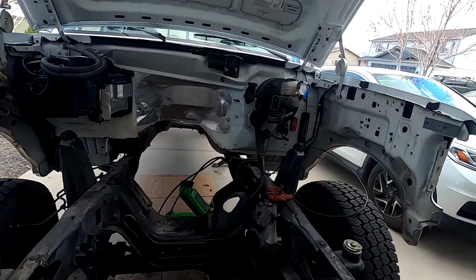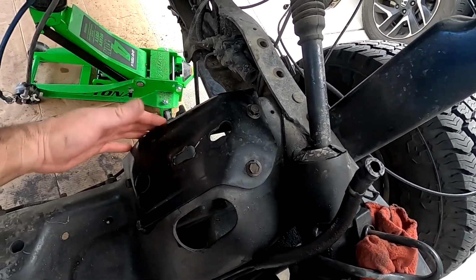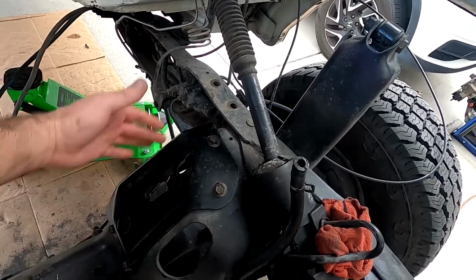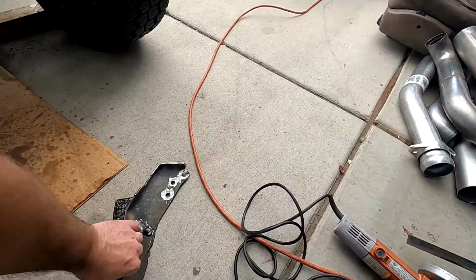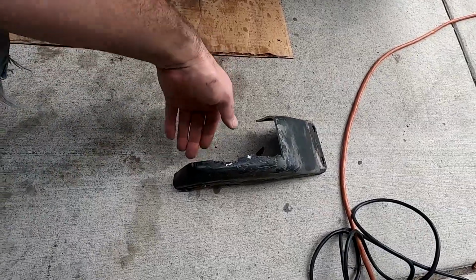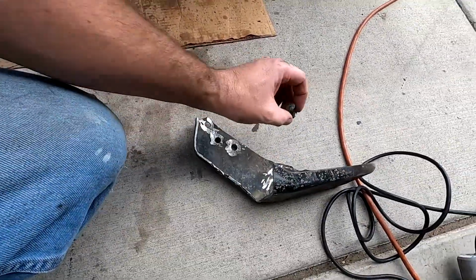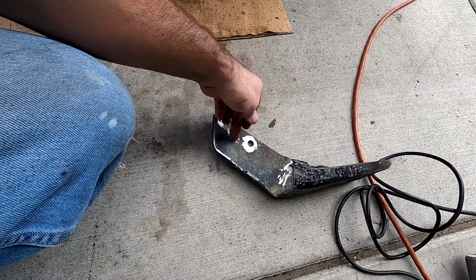All right, guys, we're back. So I got the 7.3 motor mount installed. That other one, just a pain in the neck where they had all that stuff riveted in. I couldn't get a grinder up underneath there from either side, and I couldn't get any kind of chisel or cutting bit in there. So what I ended up needing to do was take my Sawzall and basically cut a section of the mount out so I could get to these rivets from the back side, which kind of sucked because I had to get them from not the end that you would normally cut off. I had to get them from the bigger end, and you can see I just had to grind them down,